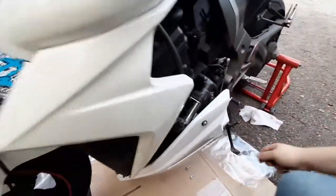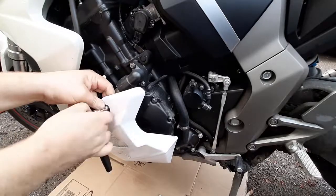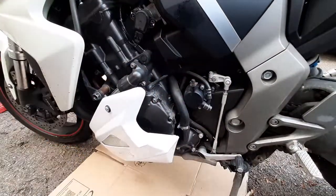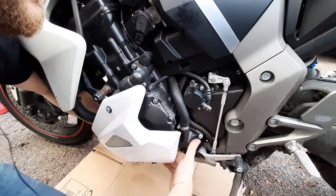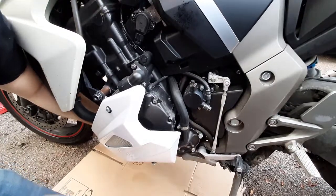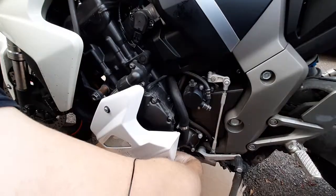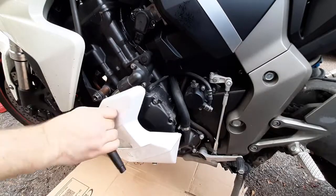And then the last nut and bolt we'll need to tighten is this lower. I'll tighten this just a bit. There it went. And then just the opposite nut. I recommend doing this with a bike hold, because with my hand here I'd definitely burn it if the exhaust was hot. And then lastly, this one.